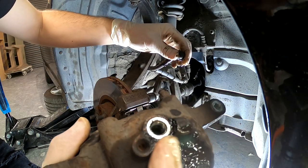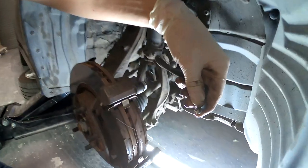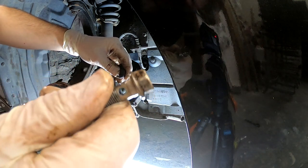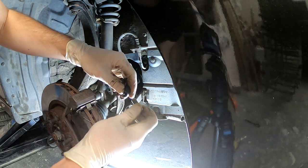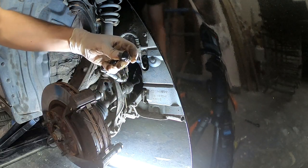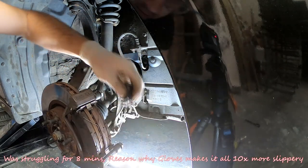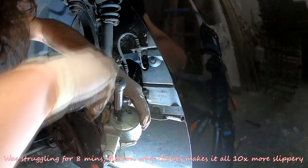Now if you look — there's an o-ring right here. One o-ring is here and you can see the shiny surfaces — two shiny parts. The bolt has holes and that's how the brake fluid goes in. My hands are slippery. Now I need to put the bolt through and screw it into the new caliper, aligning it so the leg goes in the hole — like that.